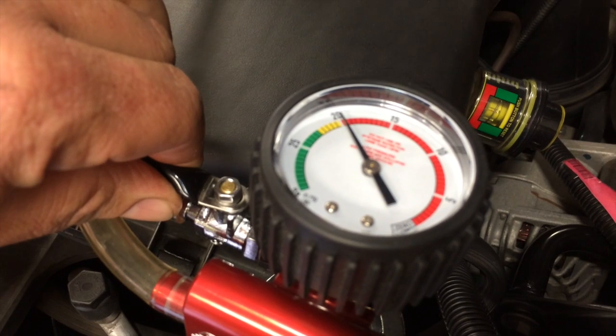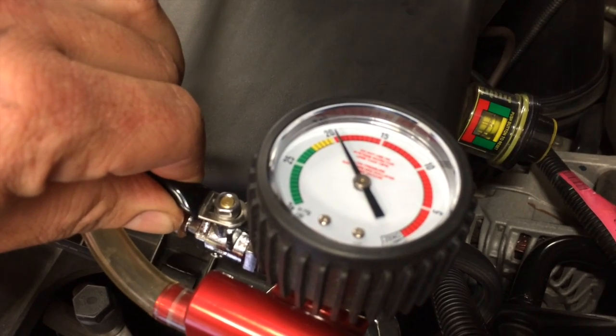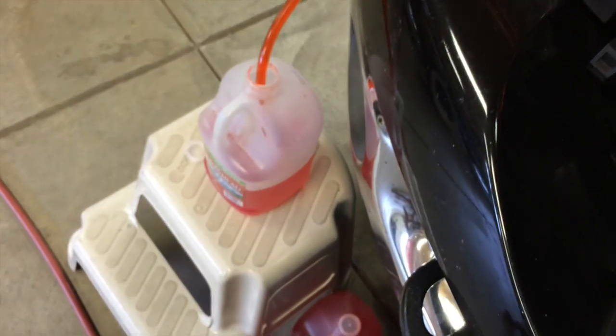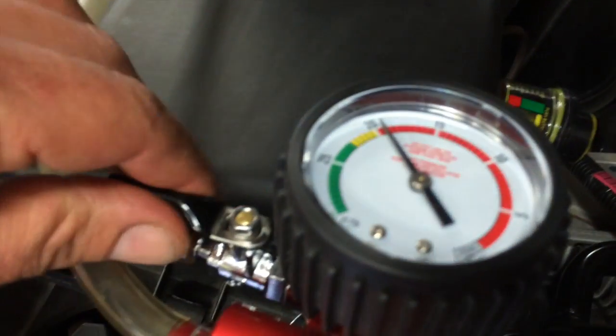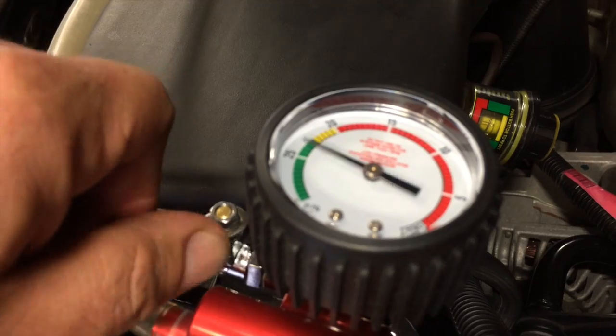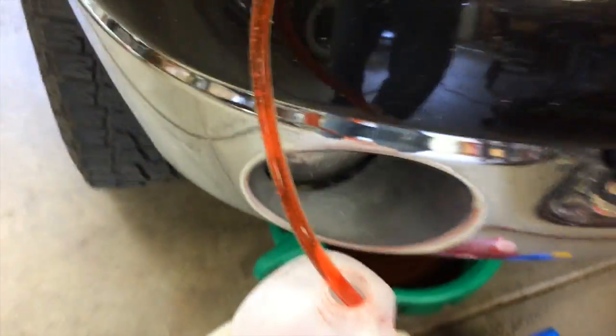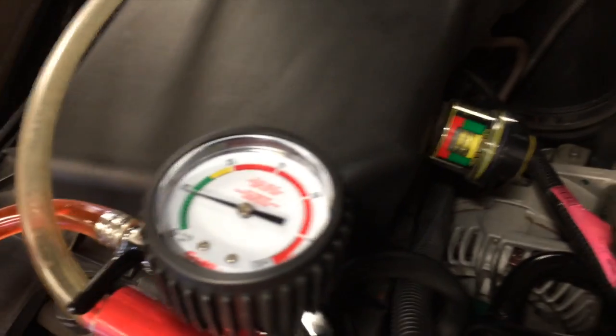Then you're going to hit a point right around between 15 and 20 where it just sits there and just sucks it in. And keep an eye on the bottle. It's going down pretty quick. But again, I got to put 4 gallons into this thing, at least, because that's what I got out of it. And as I get towards the bottom, close the valve. Then you can tip this to get more out of there, and then dump the rest into the next bottle. Then as you see, when I shut it off, it jumped back up again, which is normal.